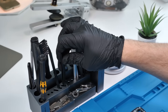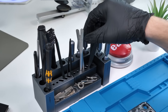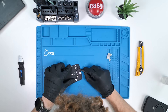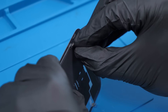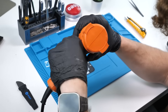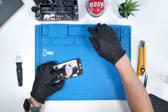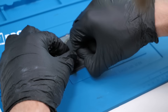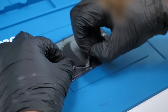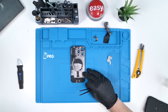To make this transparent we need to carefully remove everything, starting with this graphite paper. We'll take some tweezers and peel up the corner because I want to get it all off in one shot — but it's not all coming off. We're going to apply some heat to make this process a little easier. We need to remove as much as possible around the wireless charging coil so we can remove it without problems. Now I think we have enough of the graphite paper off.